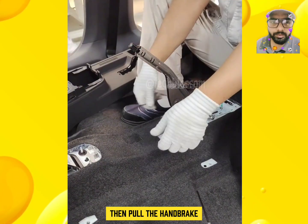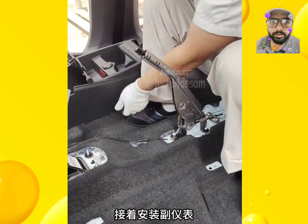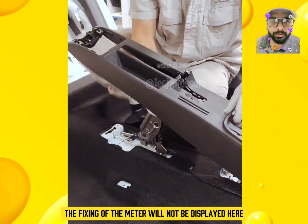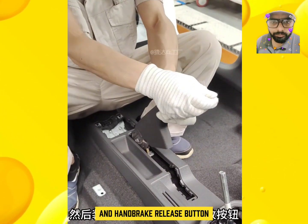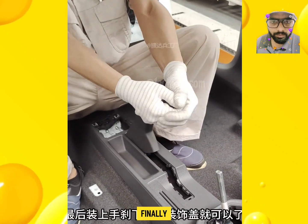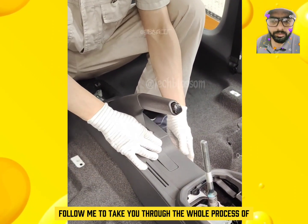Then pull the handbrake. Connect the mechanical handbrake touchpoint switch plug and arrange the wiring harness. Then install the instrument cluster. The fixing of the meter will not be displayed here. Then install the handbrake sheath and handbrake release button. Finally, just install the decorative cover under the handbrake. Follow me to take you through the whole process of car production.